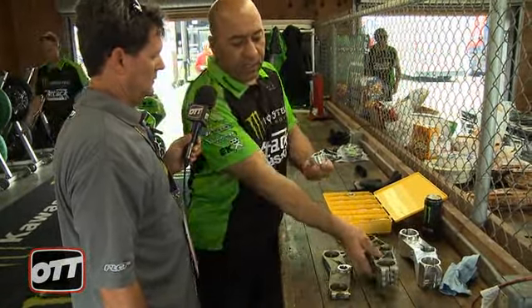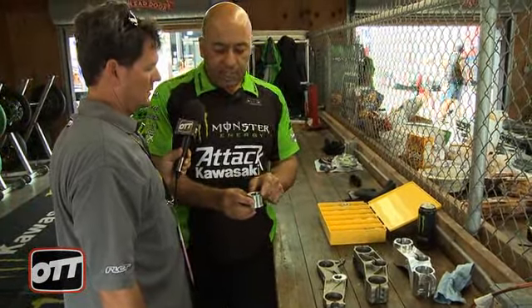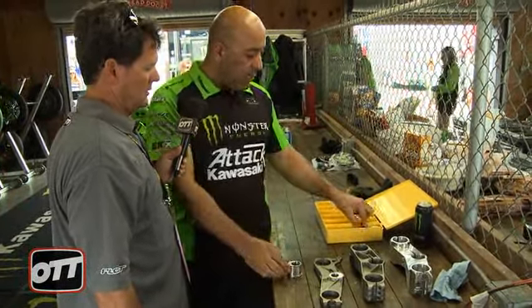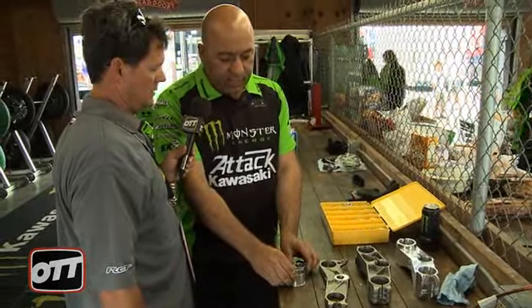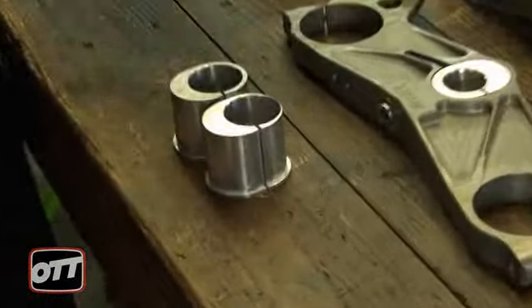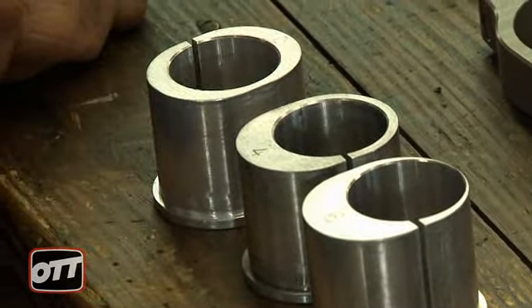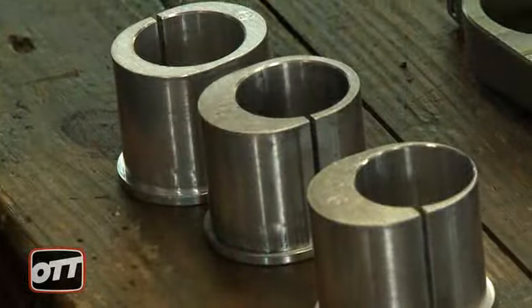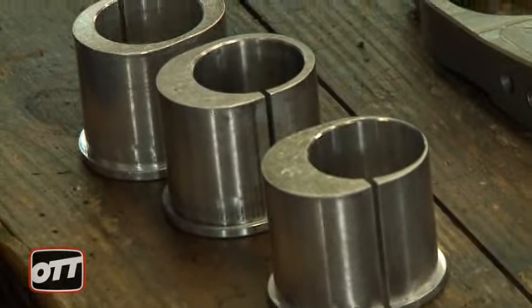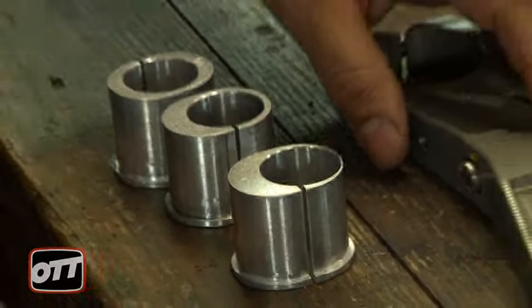Let's say there's a four millimeter offset insert — see how there's a fatter side and a narrower side? You would take something maybe with even more offset. These are all in millimeters, so you'd change your offset — and that would change your trail number. You want to change obviously both top and bottom because the stem can't zigzag.